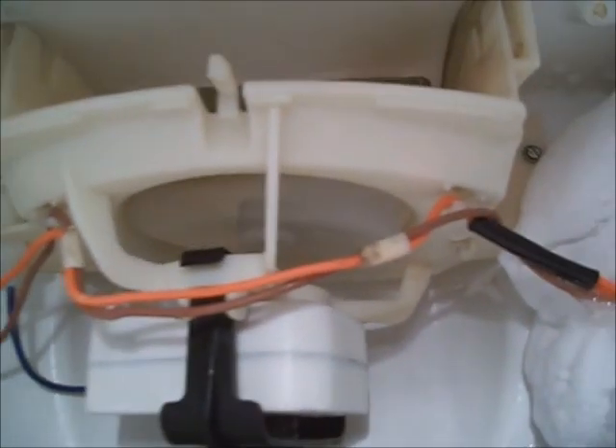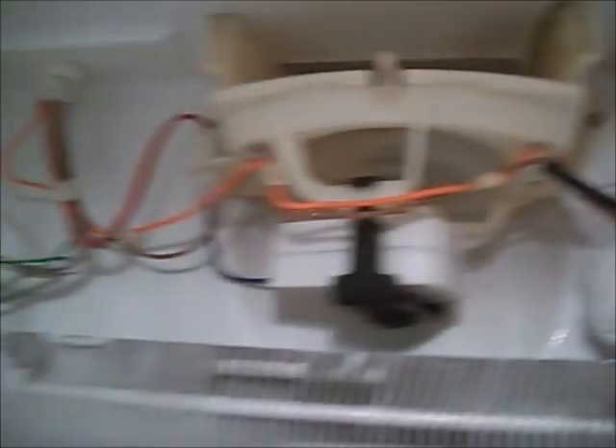You can see the fan's not turning very fast — it was actually stuck and I got it moving, so it's going to need a new fan. You should hear that fan running. That's a pretty good piece of ice but it's not blocking the evaporator. The fan is turning too slow.